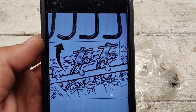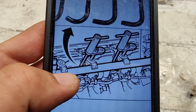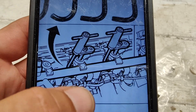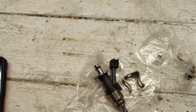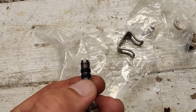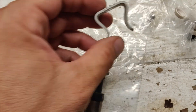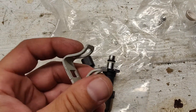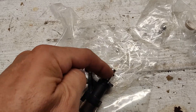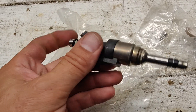Hopefully this will penetrate enough to free it up, because it feels like I'm going to break something. That bolt right there might be the key — when we come back we might swap it out to pull more from this angle of the injector. So I was just doing some research trying to figure out how I'm going to get this rail apart. Looks like those things do go in those holes above the rail, but you can't get those bolts out — they're pressed in with sleeves, they just slide and spin. So I'm thinking: this is the injector here, we got a new one. It's stuck in the head right here due to corrosion down this shaft. But it is held onto the fuel rail from this piece which basically slides over it. I'm going to try to bend this and pop it off the rail so the rail will come off the top and the injector stays stuck in the head. I'll have more leverage that way, and it doesn't matter if I mess the injector up — I just don't want to mess the rail up.